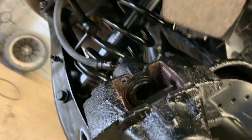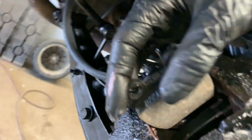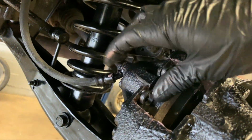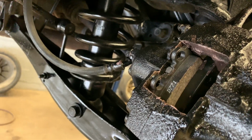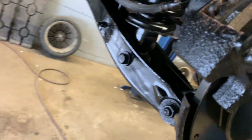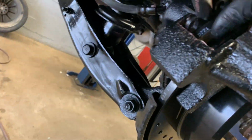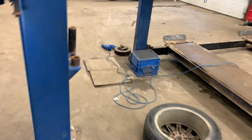And you're literally just going to slide it in between the rotor, just like that. Like literally, slide it on in. Now once you slid in, let's actually twist this rotor here a little bit. Okay. Now, because the brake pads were new in the rear, or semi-new, but they were driven on a little bit, so I'm gonna have to compress in the rear caliper just a touch.